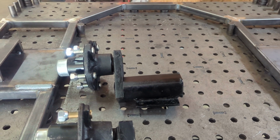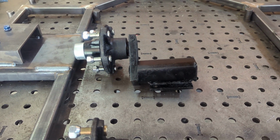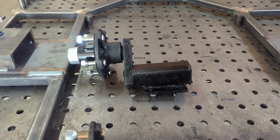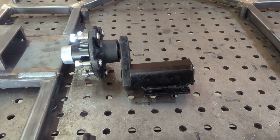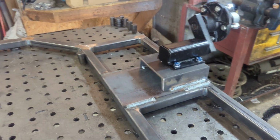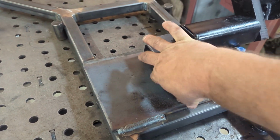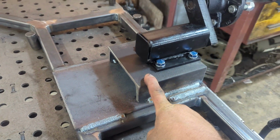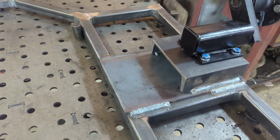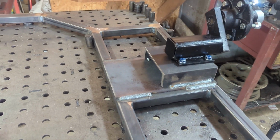so it's a better setup on your suspension, because the lighter they are, the better they are, because 500, 600, 900 pound axles make it to where it gets harder and becomes like a hardtail. We don't want that. So as you can see, we've cut it, we've welded the new piece on the back, we sprayed it, and then we've modified our frame. So now our frames are heavier duty right here, and they also are bigger here. So it's adding a little bit more weight and a little bit more cost, because we had to add these.